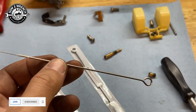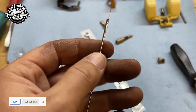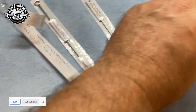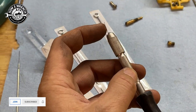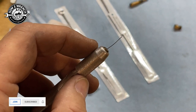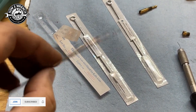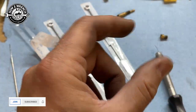If you use a small enough needle and just poke through — what I love about how sharp this is, and it's a nice handle — if you're just poking the first little bit to break up the varnish, I think this is great. Then I would go back to something a little less aggressive. The problem with the wire is that it can just bend and you're not making any progress. Where maybe this, since it's nice and stiff, would get it just started, and then you keep putting carb cleaner through and work yourself to something that's not as rigid.